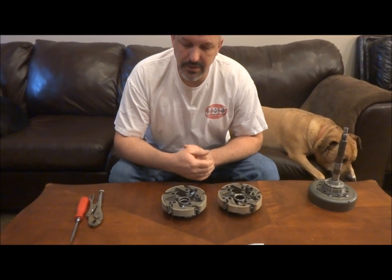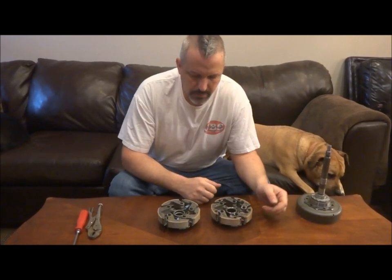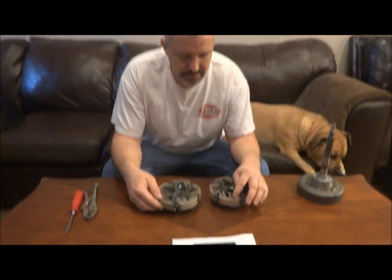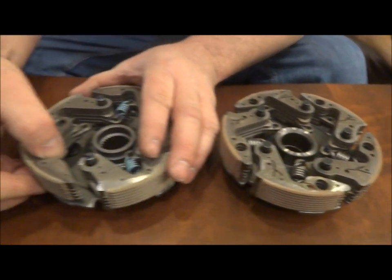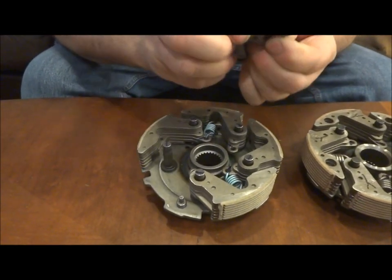I figured I'd look into a couple things on the Kawasaki T2 and T4 wet clutch, and what I found is when I tore them apart, we was going to do slugs, but as you can see, this is the Yamaha clutch, and it has a hole for the slugs, and then this is the Kawasaki, which does not. I'll show you another thing too here.